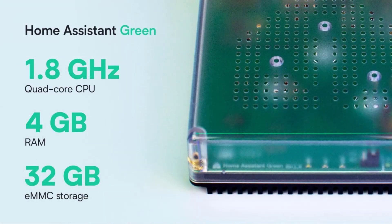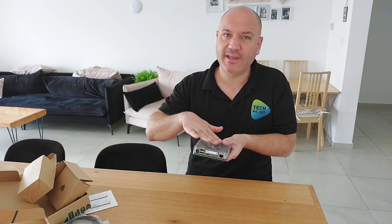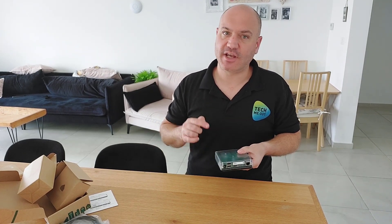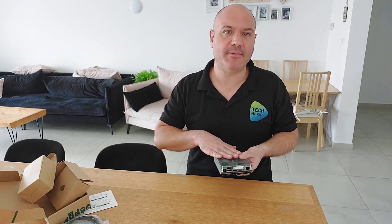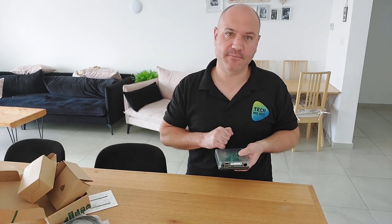In regards to the internals, you get a quad-core CPU, which is not a very powerful CPU — it's more on par with a Raspberry Pi 4. You get 4GB of RAM, which in my opinion is not only the sweet spot, it's even above that — 4GB is plenty. And you get 32GB of eMMC storage, and I'm really glad to see companies move away from using SD cards as primary storage. SD cards are highly unreliable and can fail after a few months of use. eMMC storage is reliable, it is durable, and it is plenty of storage.